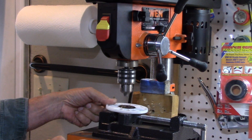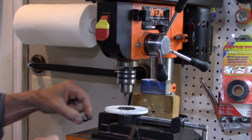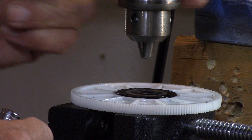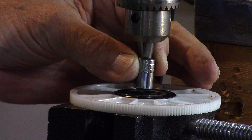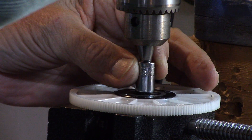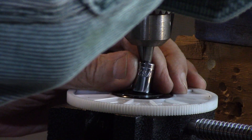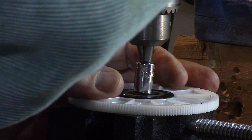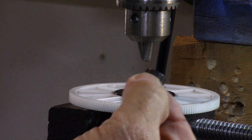I've got a little wedge here, and I'm going to set this down on top of that. I'm going to take the new bearing and set it down here. I've got an 11/32nd quarter-inch drive socket. Close the chuck and make sure that it's centered on there, then crank down on this slightly, making sure you're totally centered on the bearing and everything is straight up and down. When you crank down on this, that bearing should pop right out — just like that. And there is the old bearing.